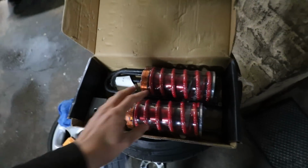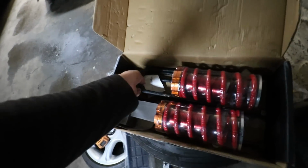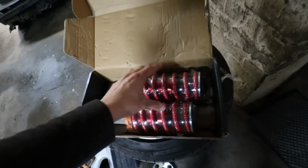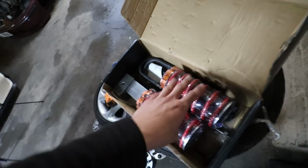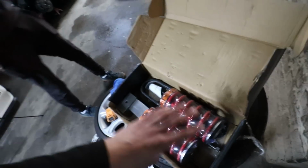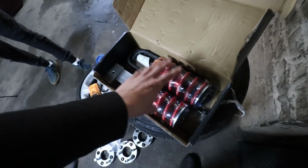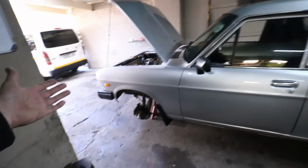We will be lowering Jody's champ bakkie today with this specific kit right here, which is a combination between lowering blocks, these U-bolts, and the sleeve overs, only two sleeve overs. You can choose between two different spring rates if I'm not mistaken. This is the lower spring rate and you get a higher spring rate as well. You can choose between the two depending on what drive comfort you prefer in your specific champ vehicle.